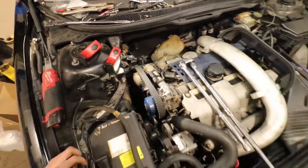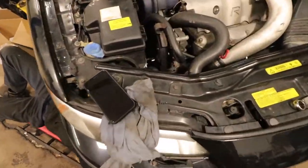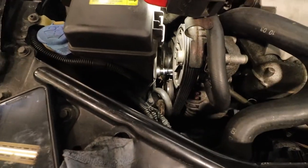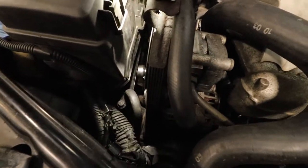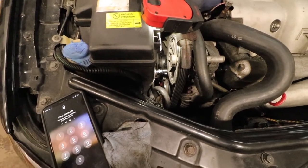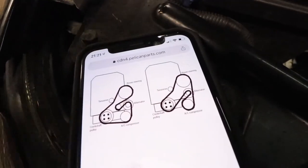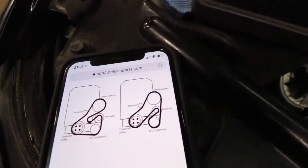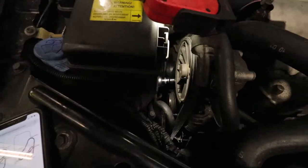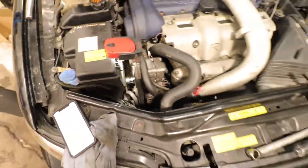It's right behind the exhaust manifold underneath the valve cover — you'd need the head off or a borescope to see it. The serpentine belt tensioner access was tough because the AC lines are right above it and the frame rail is there too. We left the top one off and used the slimmest T60 tools we could find. We left the top power steering pulley for last so as he tensioned from the bottom, we got the last one on top. Make sure to follow the correct belt routing diagram — we confirmed ours on the car.